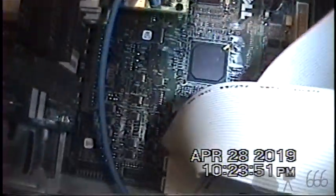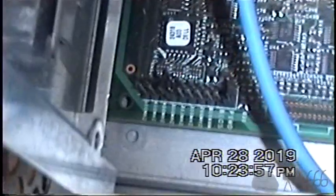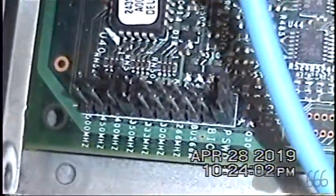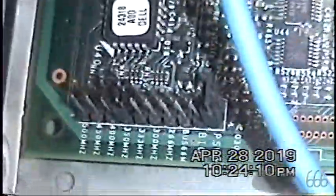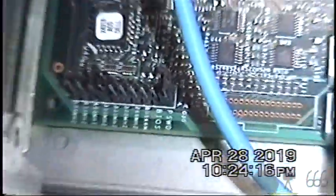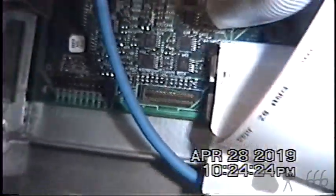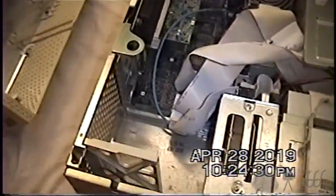I could've just looked over here and figured out the CPU speed, because it actually tells you right there. Looks like the options go 266, 300, 333, and it's set to 350, with 400, 450, up to 500MHz. There's also a bus 66M setting there, but I'm not entirely sure what that does. I would've thought that one connector would go to the business audio speaker, but I guess not — maybe this machine never had provision for one.